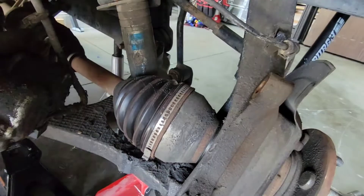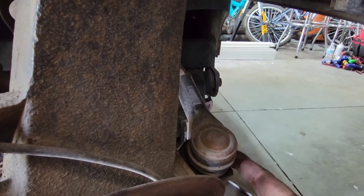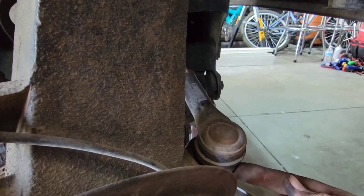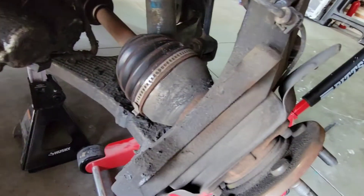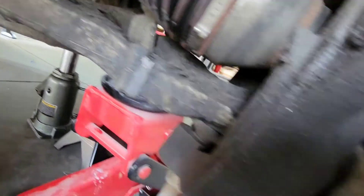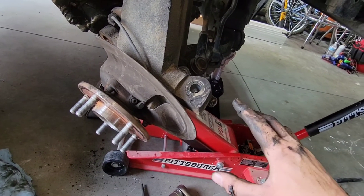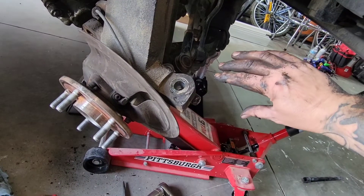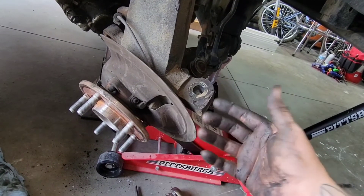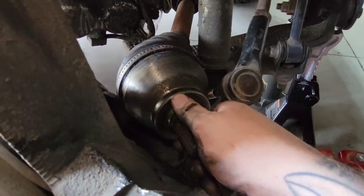Now that it's loose, try to push the half shaft back and pull it out. If you can't, you'll need to loosen the outer tie rod — also 13/16ths — loosen the bottom nut, hit it a couple of times, and be careful not to pry on any rubber grommets because that's where all your seals are. If you still can't get it off, you'd have to remove the lower ball joint, but normally you can avoid that. The trick is to turn the steering wheel to the right — pulling the spindle that direction — and then you can push in and pull up, and the CV axle pops right around the spindle.